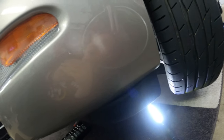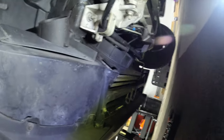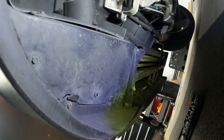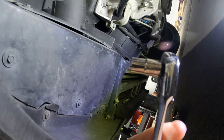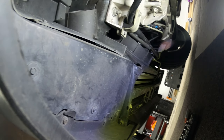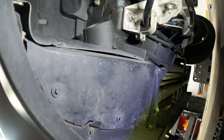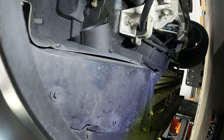My car is jacked up. We're going to do the driver's side for this video. There's our bulb and we're going to loop under here. I already have my light in place. We're basically going to be removing this thing here, and there's a little L-shaped cover in here. They are all going to be done with a seven millimeter. You can use a socket, whatever you want. I found the little quarter-inch drive is fine. These aren't torqued or anything like that. We'll start taking all those off — just stay organized. Take off the air dam first, and then the inside part next.